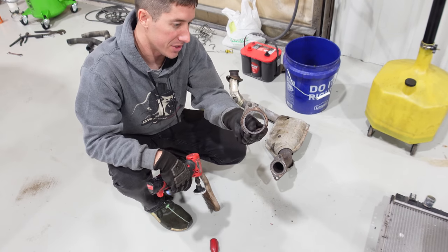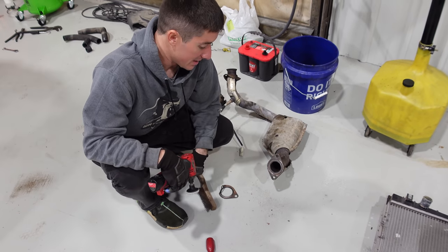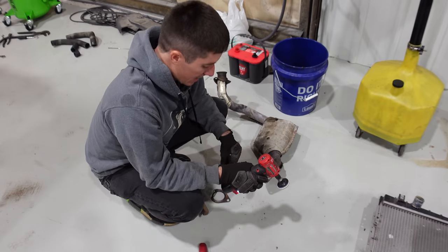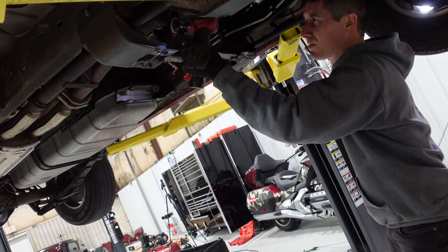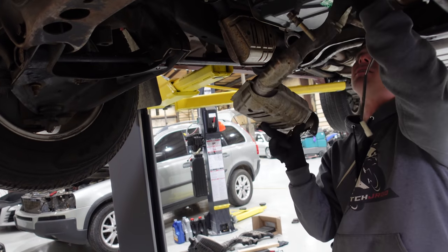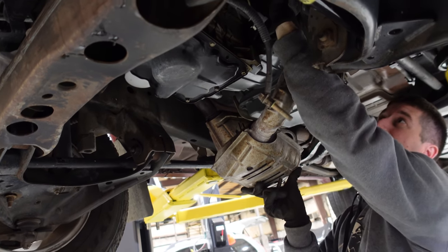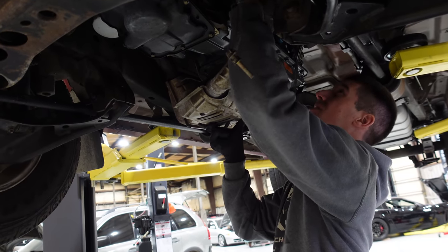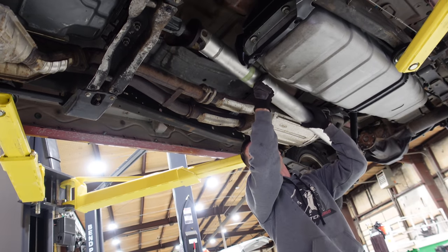We grabbed the new exhaust gasket — which took another trip and was incredibly hard to find. That is the Felpro 61061, and it's not easy to find that gasket. So now we're cleaning up the mating surface and we'll throw in our new gasket and finally put this thing together. That was really holding us up — it took another two hours or so to go find it, pick it up, and get back here. Exhaust going in — it's a ball and socket from the factory. I'll get one of these bolts started, top one, then put in the gasket and that rear center bolt.